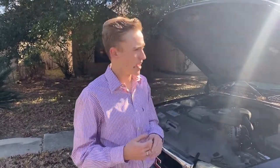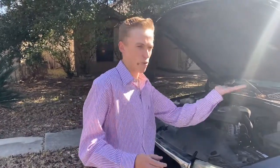In traffic, holds idle. A lot of idle and misfire issues, I would start with plugs and throttle body cleaning. You're supposed to clean your throttle body every 2 oil changes. A lot of people don't do that. A lot of people don't know that. I didn't know that until I started working on cars. You do that, and it may seem like overkill, but what's the harm? Spray it on a rag, wipe it, good to go.